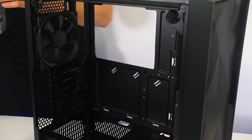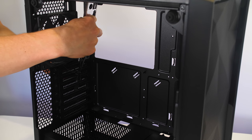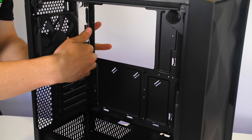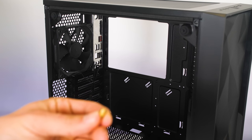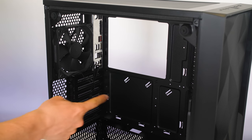The motherboard is prepped and ready to go — let's install it inside the case. Remember the IO shield we set aside earlier? This is where we need it. Grab the IO shield and push it into the cut-out in the case before installing the motherboard. Now the accessories box becomes very important: we need to install our motherboard standoff screws — little hexagon-shaped screws that go into the back of the motherboard tray. We're using a standard ATX size motherboard, so we need to slot them into the ATX positions.